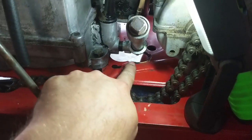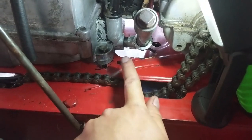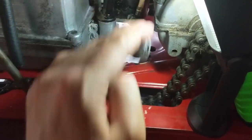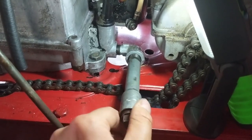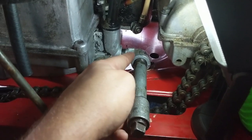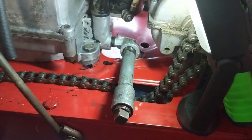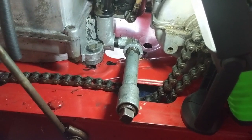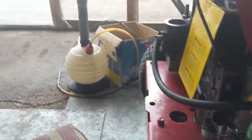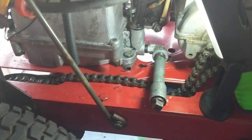With the engine on the machine I can't simply bend the elbow because it hits the thick steel frame, and I don't want to grind further if I don't have to. The customer gave me the okay to remove the drain tube entirely. The plan is to use a sawzall to cut the elbow off, unthread the fitting, then install an end plug with Teflon tape, tighten it with a wrench, and replace the chain guard. Oil can be drained using a Pela extractor going forward.